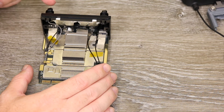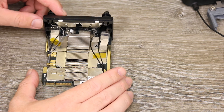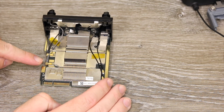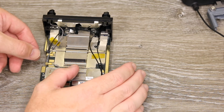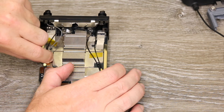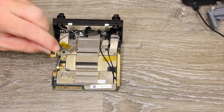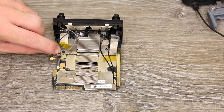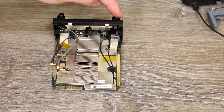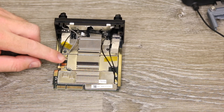Something else that was asked is whether you could change the main antenna connections, and my answer to that would be yes. They are simply wired down and connect onto MMCX ports on the left-hand side. These will pop off with a gentle tug — there we go — and they are standard MMCX connectors. So in theory you could very easily replace that with a different connector, or simply repair it and plug the wire back into the MMCX port on the radio module itself.